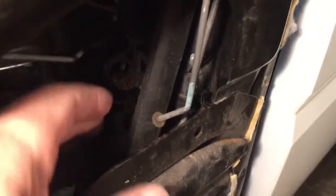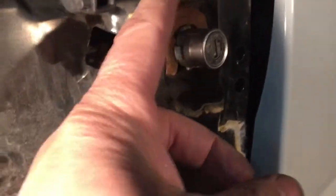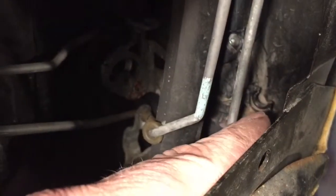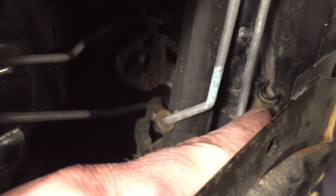My phone went dead, but I got it back charging now. So what happened: I got the lock cylinder back in there — it just slides in. The retainer clips in behind it, and then this linkage hooks up there, comes down, and hooks into that keeper. That snapped, and that triggers the unlocking mechanism.